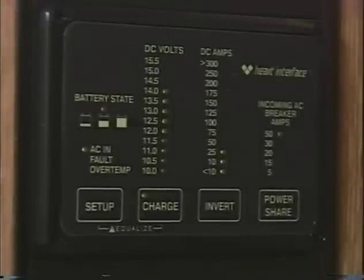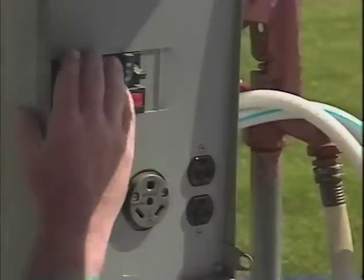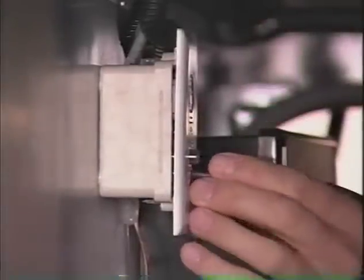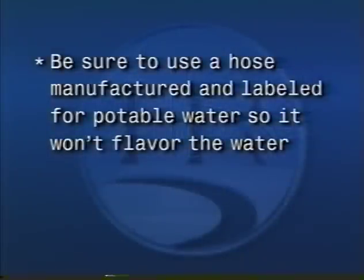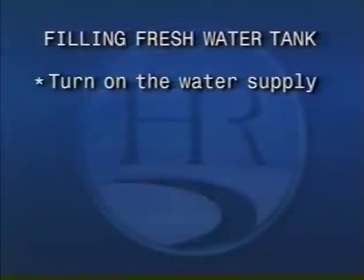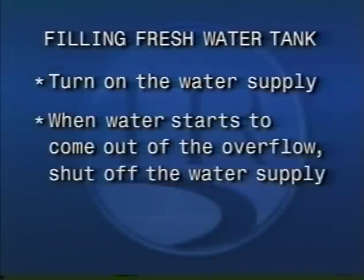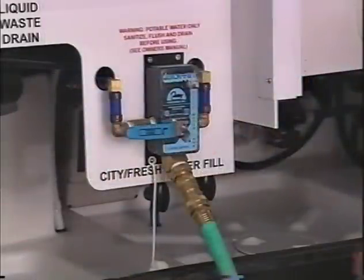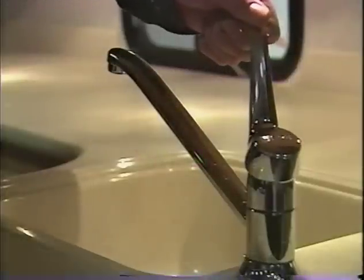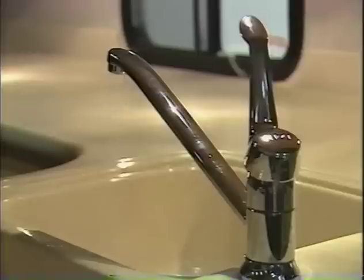Before plugging the power cord into shore hookup, make sure you have the shore power set to the proper setting on the set shore power screen on your inverter, depending on the shore power available. Turn the shore power circuit breaker off, plug in, and then turn the circuit breaker back on. Connect to cable TV if available and plug in the phone jack, which provides a connection throughout your coach for a phone as well as your optional satellite system. When connecting the motorhome to fresh water, be sure to use a hose labeled for potable water to ensure the hose will not flavor your water. Connect the hose to the city fresh water hookup with the city water valve in the open position. Turn on the water supply; when water starts to come out of the overflow pipe, shut the supply off as soon as possible. When staying hooked up to shore water, turn off the city water fill valve to pressurize your coach water system. It's not necessary to use the water pump when connected to city water — make sure you bleed the air out of all the faucets.